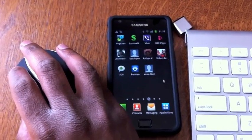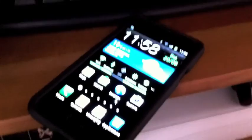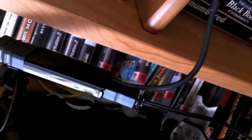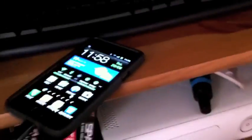It's pretty cool, especially when you've got this working in conjunction with the MHL adapter to your big screen, which I'll show you in a moment. So, I wanted to quickly show you the Samsung Galaxy S2 connected via an MHL cable to my HDTV. One end is a micro USB, the other end is HDMI. But in order to function, it still requires an extra micro USB cable to power up the device. I have connected this to my Xbox currently, and I've also still maintained Bluetooth with my mouse and keyboard — so you can still do your big screen browsing on your TV just fine.